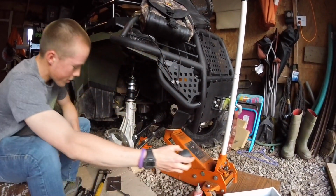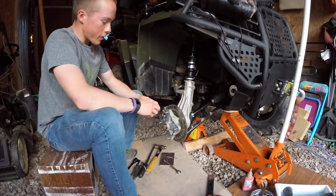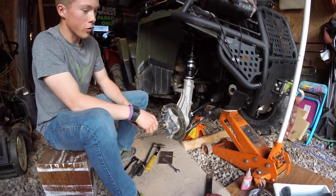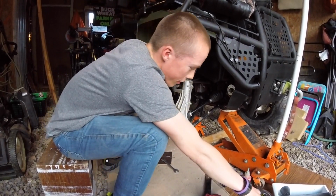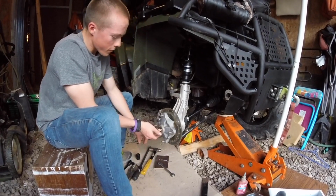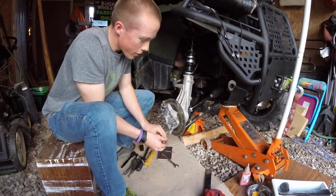And then you'll have this cover on over top of the axle nut, so you just pop that off. And then you'll get a 15/16 socket that'll go onto the nut. I've already took it all apart, so it's all loose. But it'll also have a cotter pin in it too that you have to straighten out, then pull out, and you can loosen the nut off. A washer behind it too, so make sure you grab it.